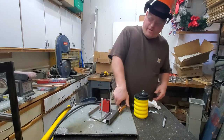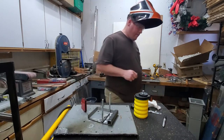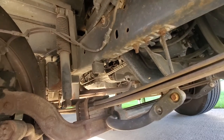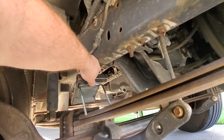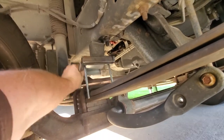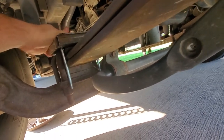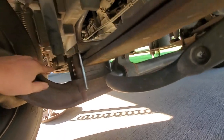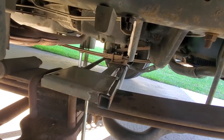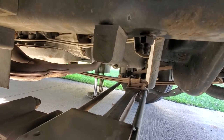And now test it under the RV. Try to get a good camera view here — it is a little tight. So that's basically what you got right there. I'll take this in the garage and finish welding it up, clean it up, get it painted. Next we'll take off that bushing and we'll install the Sumo spring on both sides and pretty much button this project up.